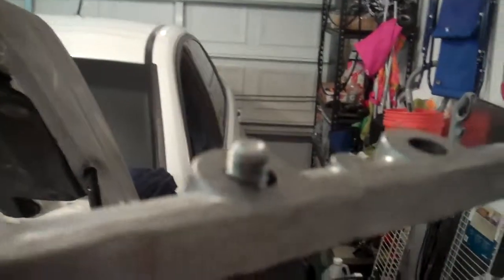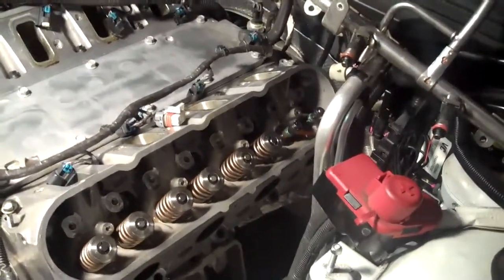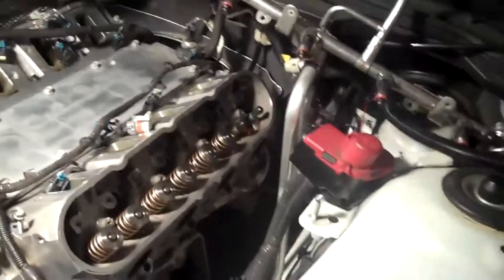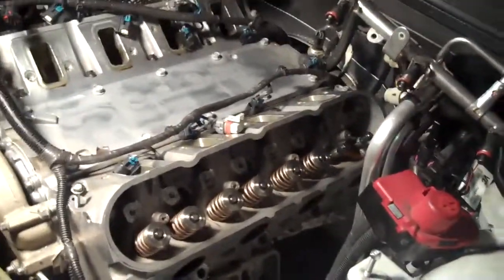As you can see, that is the only amount of thread that goes into the rocker bolt hole. I measured it and it's only one eighth of an inch. So basically you've got two bolts with an eighth of an inch of thread going into the rocker bolt holes. The instructions say to tighten these bolts to 10 to 15 foot-pounds, which I did.